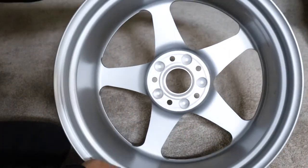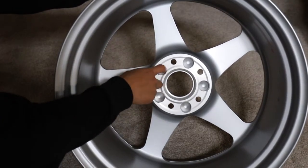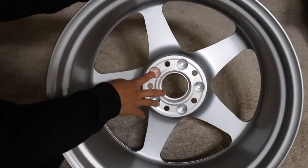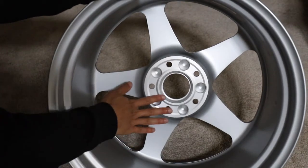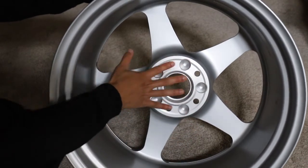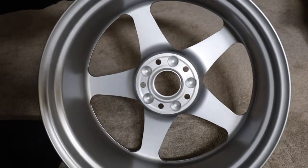Looking at the back side of the wheel, you can see the hub and the holes where the studs go through. We also have pockets in between each of the lug studs — that's again to take out some weight and potentially give you clearance if you're running a spacer where studs might be sticking through. The other detail is that on the back face there's almost a recess between the inner edge and the outer edge — the hub actually sits on these two edges, with a recess in between. I'm not sure if that's to further reduce weight, but it looks like it. Otherwise, the back side is relatively simple.